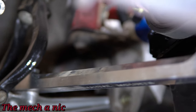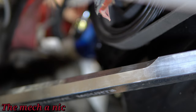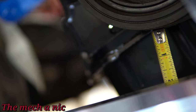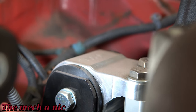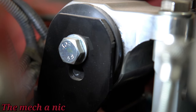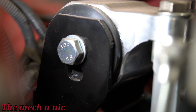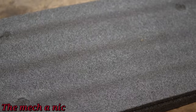Here I am on the right side of the car, and you can see the distance between the crank pulley and this arm — this is way better than I was expecting. We've got about a two-inch gap. Supposedly some people have an issue with this arm getting really close to, if not completely coming in contact with, the crank pulley. I'm using Hasport mounts on the highest setting because I prefer ground clearance over hood clearance, and I'm sure that's what's helping here.